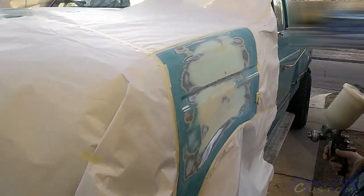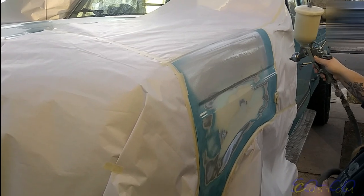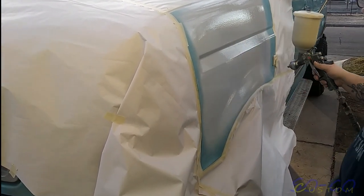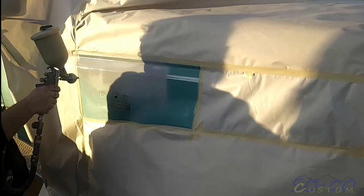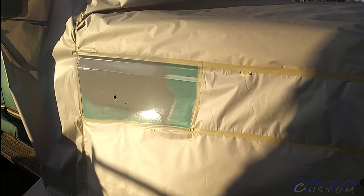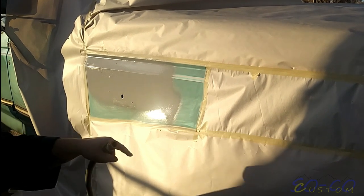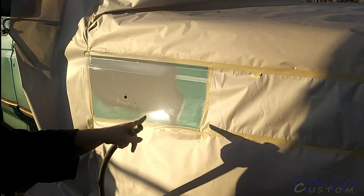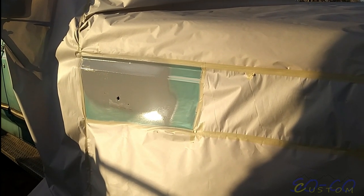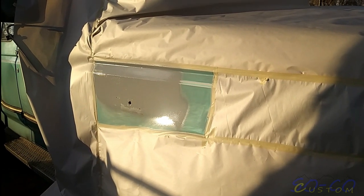Okay, scratched it up again with the 400 dry. That's it, babe? Yeah, we'll let that dry, and then I'll go over it more. Okay. See, because I was just going to spray the whole thing. Oh, we don't need to. But it did need to be sanded, because if you don't, this won't stick, and it's a heck of a time getting it off. Because if you paint over that without sanding it off, your paint will actually flake off with it because this has nothing to grab to if you don't sand it. Oh, see? Well, I'm glad I let you do it, huh? I was going to spray the whole thing. We sanded it with the 400 because when we wet sand, it's the 400, so we have no marks. Oh, okay, huh? Good job.